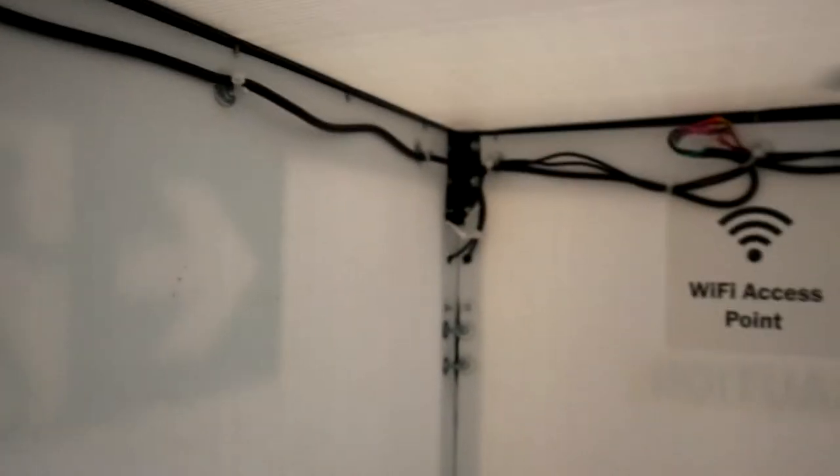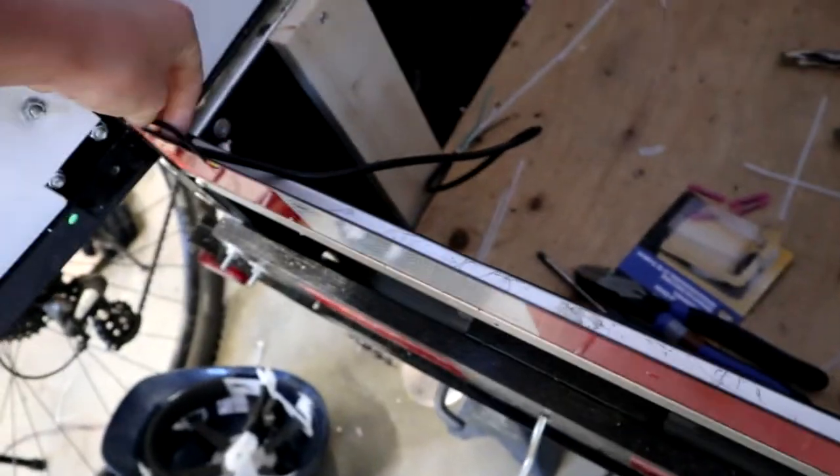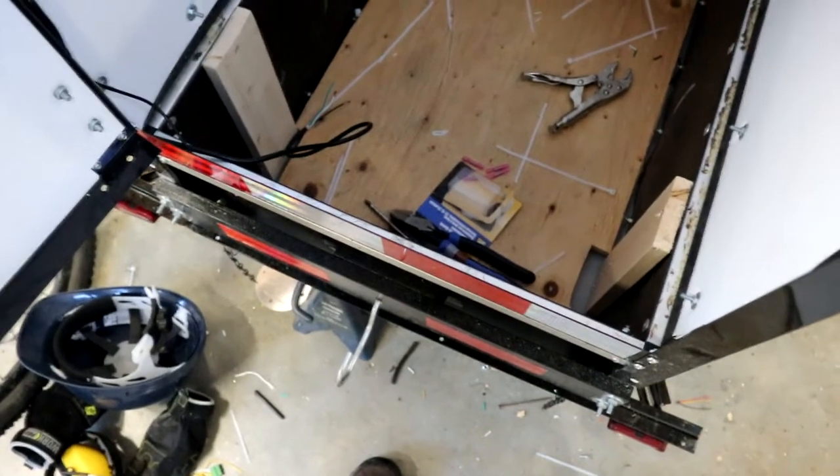The wiring goes up to this one, does that one, goes down here, then splices right there to do those other four on the corners, same with those other two, and then comes up to do this one here. So basically all I have to do is run this one down here to a short piece of cab tire, do the same with the other one, and then have their own circuit come down to the battery where I'll have it switched separately. I'll update you once these are spliced.